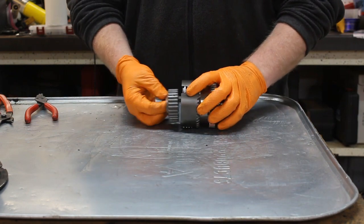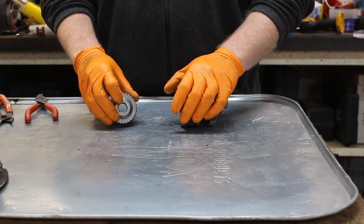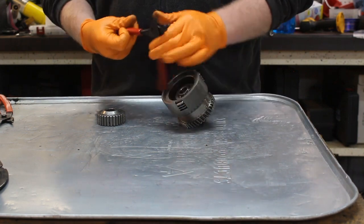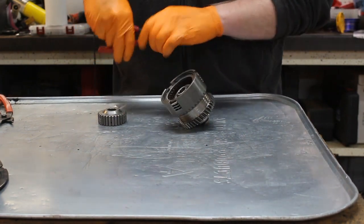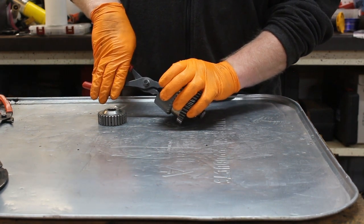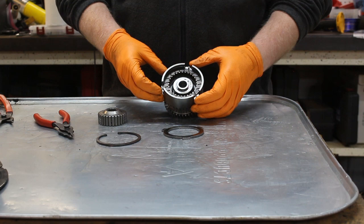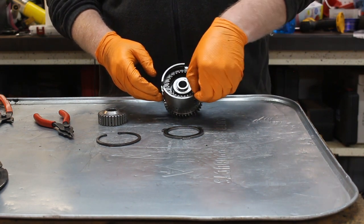We're going to pull out the gear right there that attaches to the main drive shaft. The main shaft will actually come right into this and drive this gear right there. That leaves us with all these little tooth clutch plates in here. I'm going to take this first one out. My snap ring pliers are a little bit small for this job — we're going to see if we can do it without sending a snap ring around the shop or smacking me in the face. This is the pressure plate right here. I'm not going to disassemble this too far for fear of losing springs.